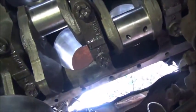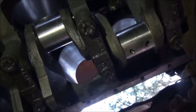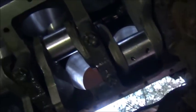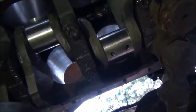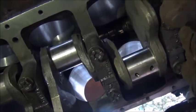Sure was messy - won't forget to do that again. What I do is torque one at a time, then turn the engine before I do anything else. When I build an engine I do that on the mains too - torque one, turn it - because if that engine is going to lock down you want to know which bearing caused it. If you put it all together and it's locked down, you won't know which one it was. Anyway, that's one down, seven to go. We'll get the pan back on, everything cleaned up, then start getting the top together.